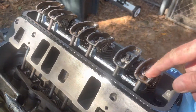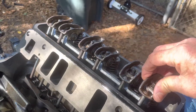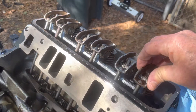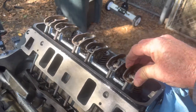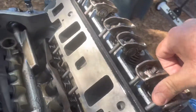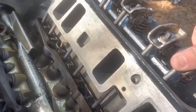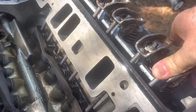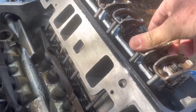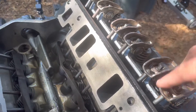What I've done is I've cleaned all 12 of these. I had to get the old oil and water mix out of them and now they're completely empty. To make sure they pump up and don't fail, I want to run through a cycle and pump them up. Right now you can see the preload — if I push down, you can see I'm pushing on the spring. There's a spring inside the lifter and I'm compressing that spring, but this lifter is preloaded. It springs back and has a preload to it. So that's number one.